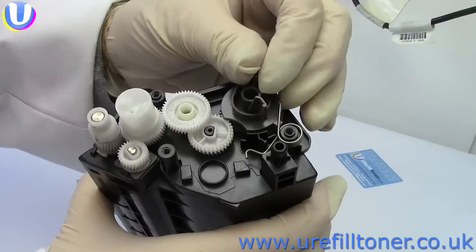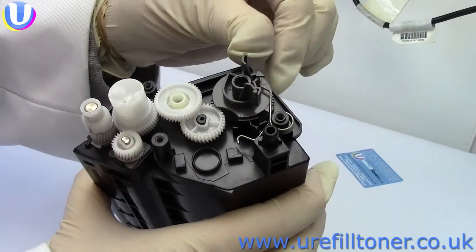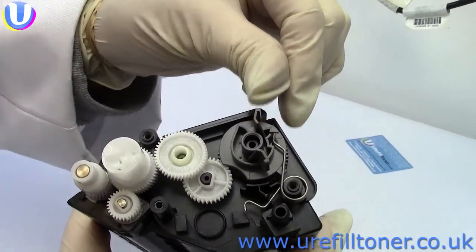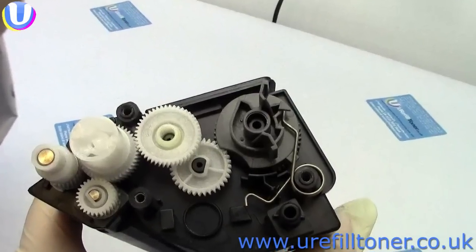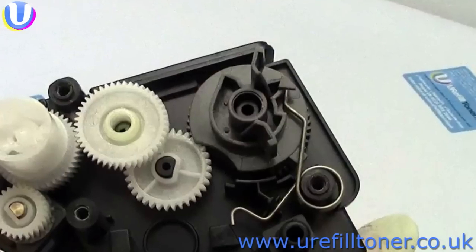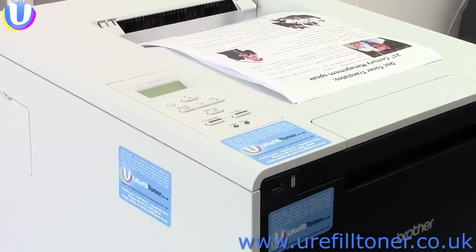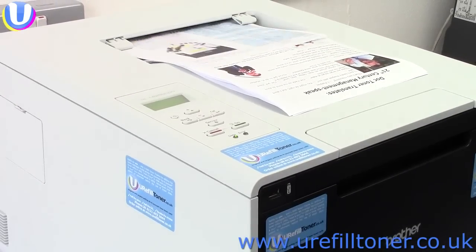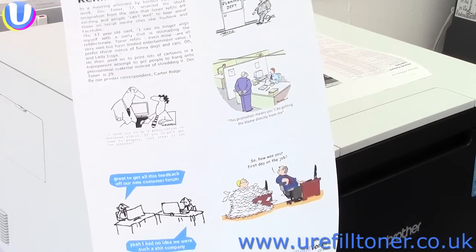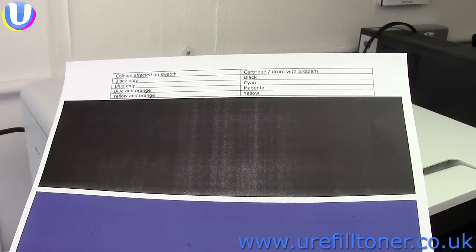structure. The spring then brings the notch to this position here, and you can check you've got it right by just flicking the flag like this and seeing if it goes back to this position, which all the teachers' pets are now dying to shout out is none other than the loaded position we saw earlier. Remember that? So question, when, pray, kind sir, do we actually get to refill one of these puppies? Answer, when one of these puppies actually fades out because there's actually no toner left in it.